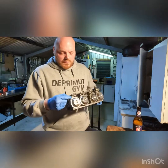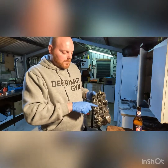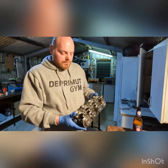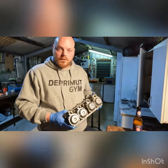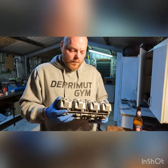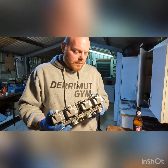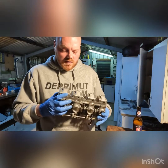Usually all you're looking at doing is adjusting these fuel mixture jets, as well as your synchronization of the butterflies, and you do that with vacuum ports that hook up to your inlet boots. So these are going to be all right. Haven't worked on many of these model carbs. They're not Mikuni or Keihin, so I'm assuming they're Hitachi, but not too sure.